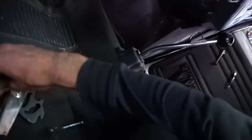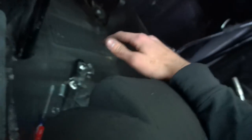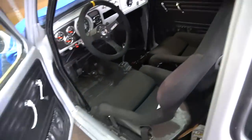To remove the e-brake handle, it slides out sideways with two little C-clips on each side — it took at least 40 minutes just to slide it out even with everything unbolted. I busted my knuckle; it's all purple and swollen. I got the e-brake button back in and I'm waiting to fully secure it until I adjust the e-brake cable. That literally took forever — I'm so irritated.